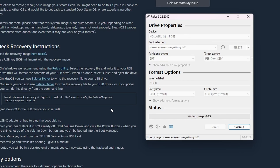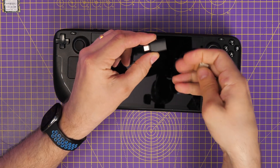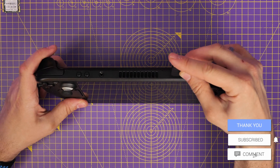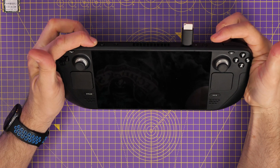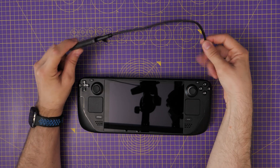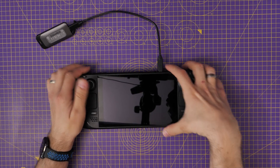This was possibly the hardest bit of the entire thing, which is insane because it seems like it should be easy. The drive I was using just didn't work — Rufus should work in theory but after half an hour I had problems with it. I tried four different thumb drives and none of them would work, so in the end I used a USB SSD from Corsair instead, which I'll link to in the description. I formatted that and put the image on there — the same process with Rufus but on an external SSD rather than a USB thumb drive.